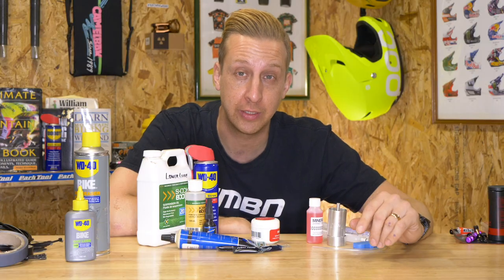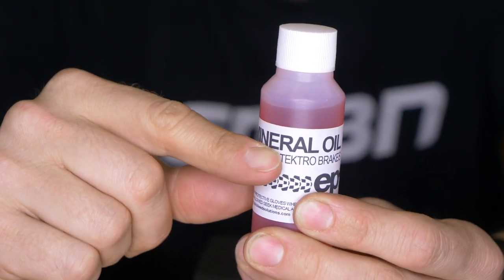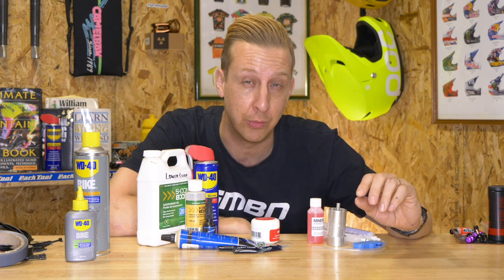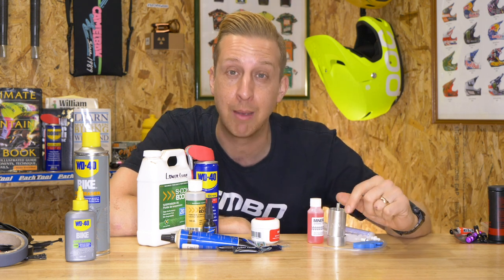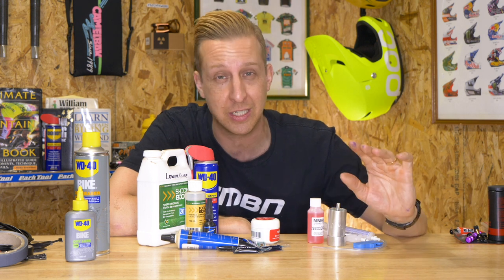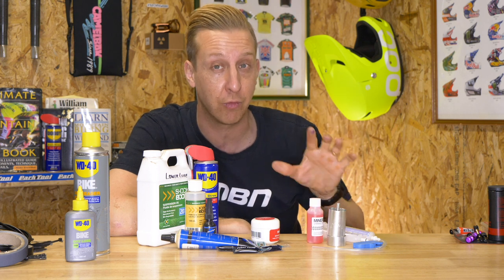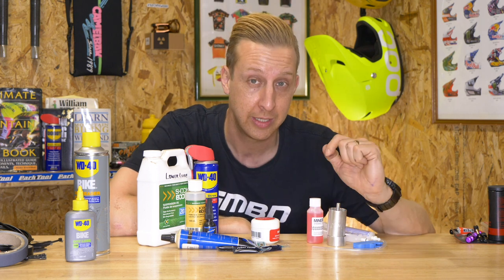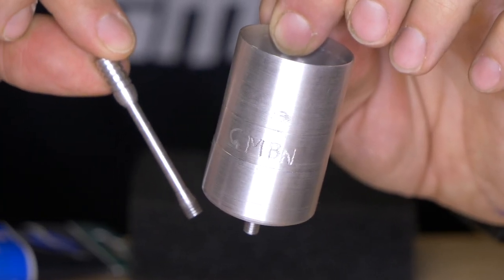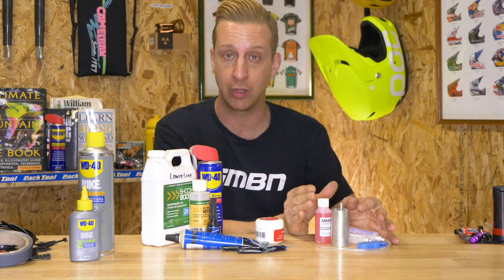It's a really good idea, if you're confident, to have a bleed kit that suits your brakes. On my bike I've got Shimano XT which uses mineral fluid, so I keep some mineral fluid. If your brakes use DOT fluid, try to keep the minimum amount you can — if stored for a long time it can ingest moisture and won't work properly. So for mineral fluid you can keep it on a shelf for quite a long time, whereas DOT fluid should be kept in smaller amounts. We've got a cool machined funnel made by a GMBN fan — just make sure you get the right kit for your brakes.